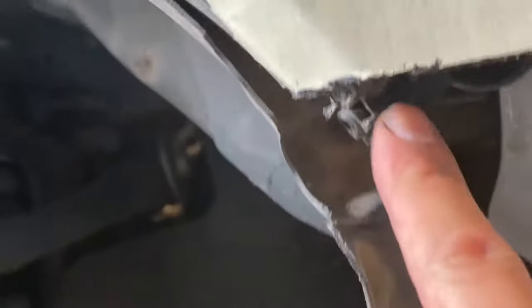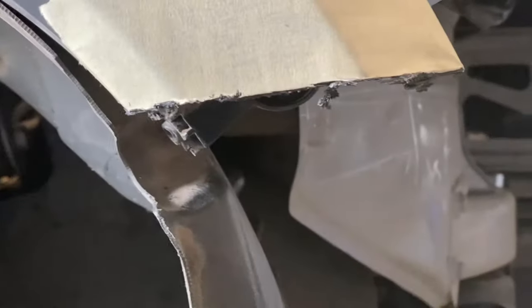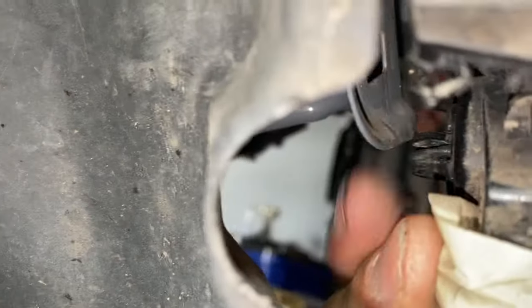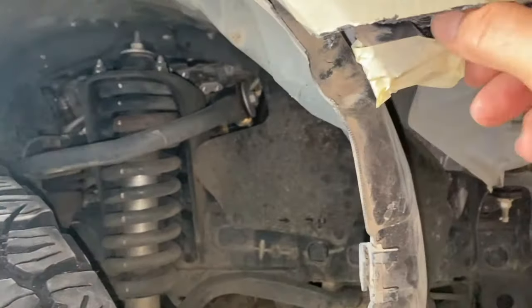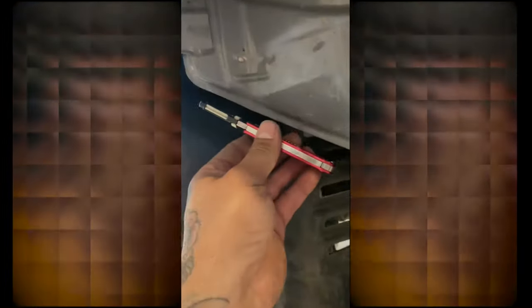To match this, put masking tape on the plastic piece and even it up with your fender flare. Be careful not to cut the metal piece that's going to hold the spacer and fender flare together — be gentle. For the fender liner, cut it with a utility knife following the line of the frame. Do the same on the other side. You don't have to be perfect — just have enough plastic to bolt onto the piece. I used self-tapping screws with some small washers.